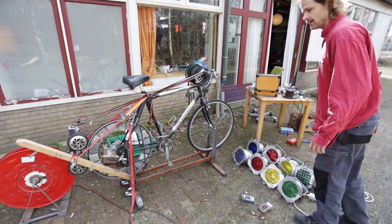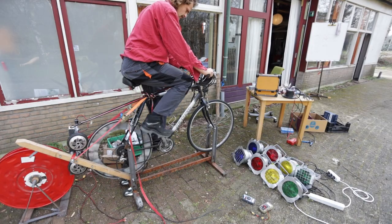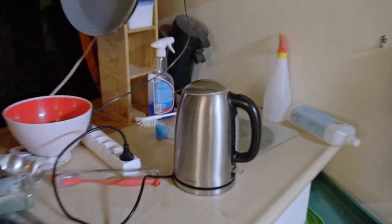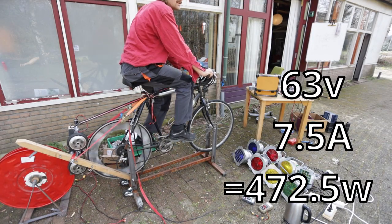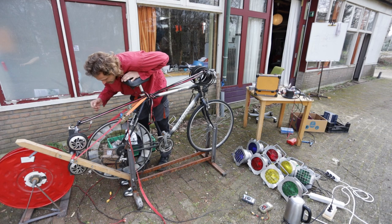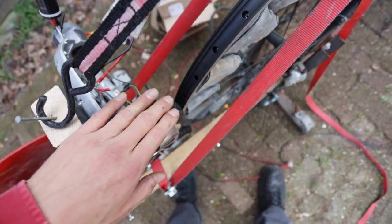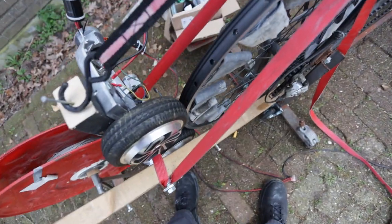That's less than 420 watts. Let's see if I can get to 420 again with the parallel cable. 65 volts, 5 amps. Back to series - it's much heavier now. I smell burnt rubber, this one is slipping a lot. Maybe it's not a bad idea to try an air tire on the rear wheel - this is very little surface area to get all this friction from. If I put an air tire on there it should be much better, though the chain is still slipping a bit. One thing at a time - air tire.